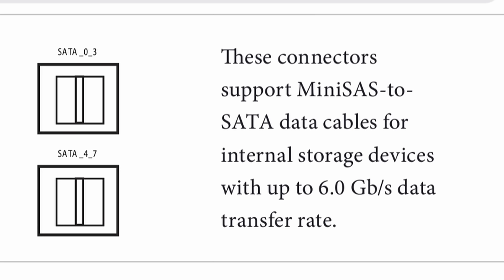In the end I reverted to the original plan of using those two 2.5-inch SATA drives in the back. I know you're thinking I said that wasn't going to work — but after further inspection I realized you can just remove that little mini SAS backplane connector and use them as regular SATA drives. Then I just left the 2TB NVMe drive in the motherboard. Unfortunately I don't get to use any of the cool Oculink slots at all, thanks to the ASRock motherboard.